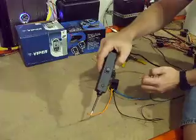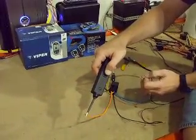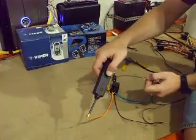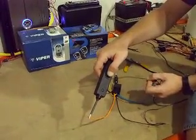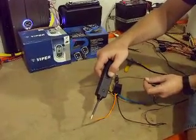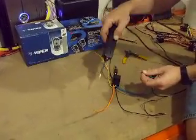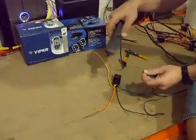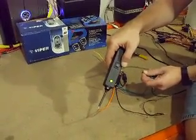This is the output wire on pin 30. When I click pin 85 coming from your car into the relay, it's going to throw ground — you can see it's getting ground. So whenever you apply ground to pin 85, it's going to connect to 87, the straight ground, and give you a good solid ground on pin 30. And that's all there is to it.